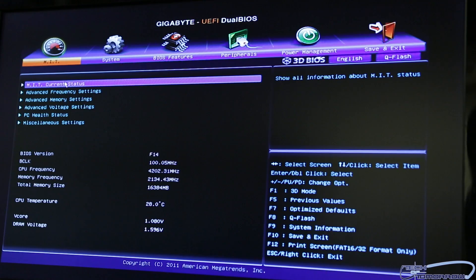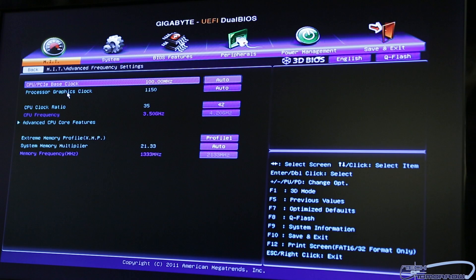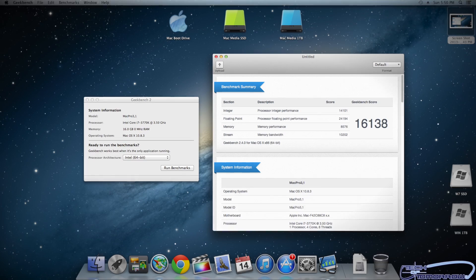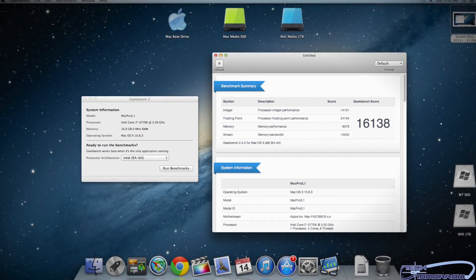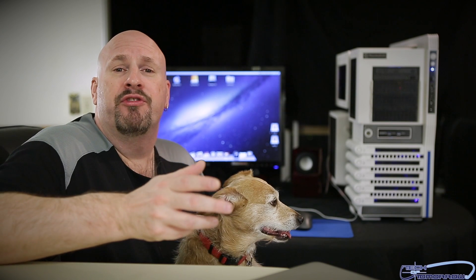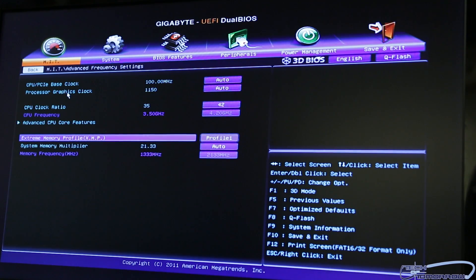This week we're going to talk about some of the things we did. First, how we overclocked it. We overclocked the CPU to 4.2, just changed it very simply — upped the voltage ever so slightly. We also set the XMP profile of the memory to 2133, so it's running faster than hell. We really increased our Geekbench score — it went from 13,800 to over 16K in scoring, which is amazing from just a couple simple changes. A lot of people, when they build their systems, don't overclock at all and forget to set the XMP memory profile, but doing that really makes the system kick more ass.